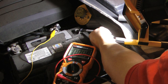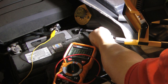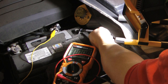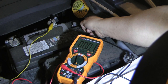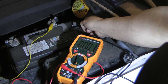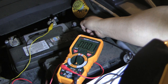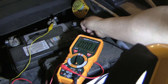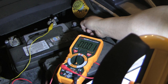You see we're getting some different amperages going through there at first, and then it levels out at zero — so I don't have a parasitic draw based on the data I'm seeing. What happens when you first connect your battery is a whole bunch of stuff wakes up, particularly in these newer vehicles. You can't judge the initial readings as a parasitic draw — you really need to let everything calm down and then see if you still have a drain.